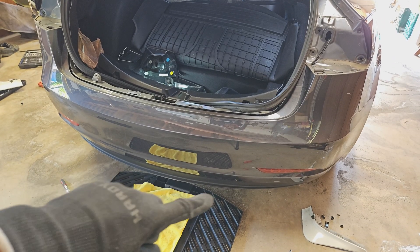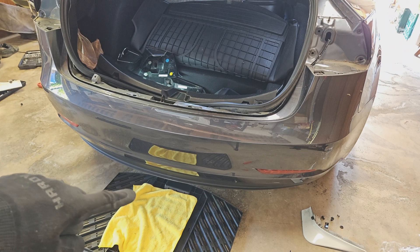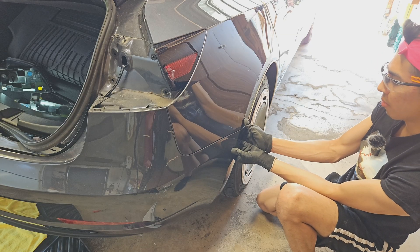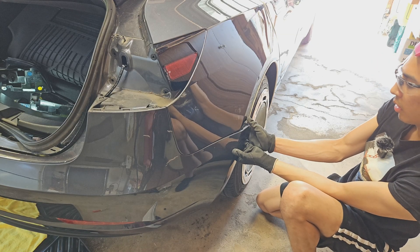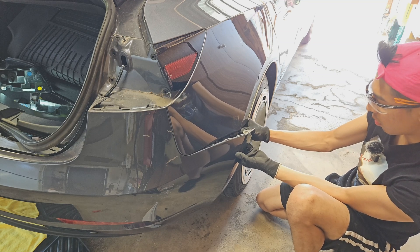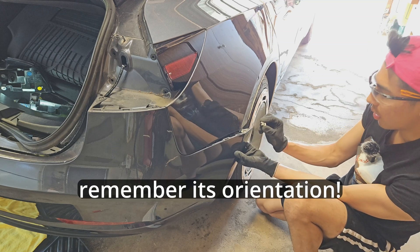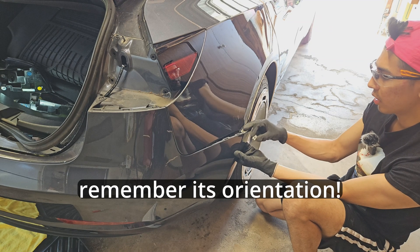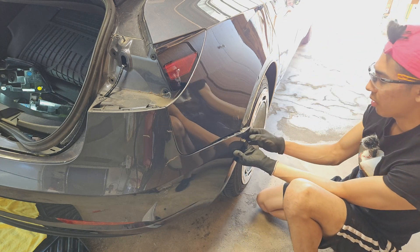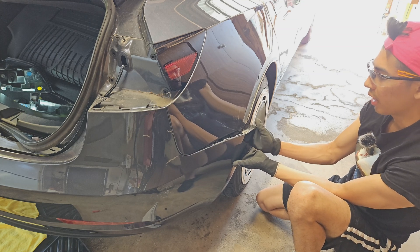Lay down a little bit of protection before removing the bumper. We're first going to start on the sides — just pull away from the car and it will come off like this. There's a little metal piece that might fall off as well, right here. This piece is for the T25 bit that we took out earlier, so keep this handy. Put it right next to the T25 — we're going to need to reinstall that later.